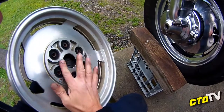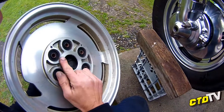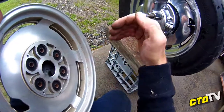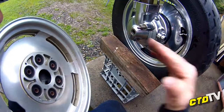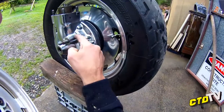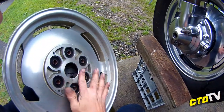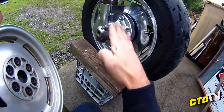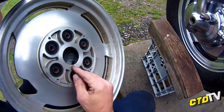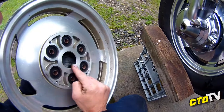Now, what they did, there's a little lip on the standard bit, it's not much, it's higher though, and they ground this down flat. As a result of that, with casting, you've always got a line that follows on the inside. The line on the outside had a little lip, like any corner of this wood, it's changing angles. Now, in grinding down the face, the angle that was on the outside was followed on the inside, so basically, it had a millimeter or two thickness of alloy holding on that center plate.